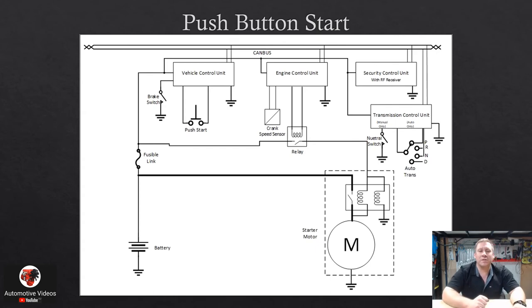We're getting more complex in our systems — it's not as straightforward as before. It's also important to be aware that a non-starting vehicle may not be because of the starter motor itself. It could be the transmission, the security control unit, or the vehicle control unit. There are several different things coming into play, meaning a non-starting vehicle may not be due to the starting system components at all.